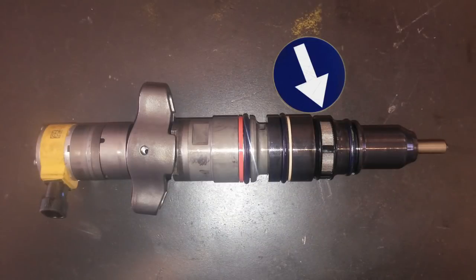What they've added is a very fine metal screen on one of the ports going to the injectors, and this is supposed to help control contamination to the injector. The problem with this is the screen is over the fuel side, and if you're familiar with my other Huey videos, the Huey oil is really where most of the injector problems seem to come from — not the fuel side. I was wondering why they would add a screen to the fuel side but not the Huey side.